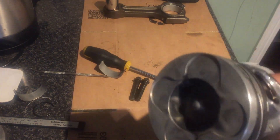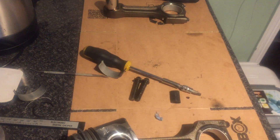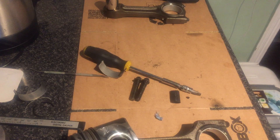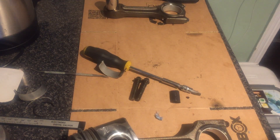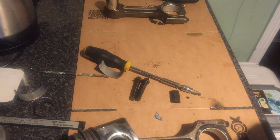There's our second to last piston. I'll do the last one and then we'll fit the last two. Then we need to go underneath and fit all the caps and torque them up. I do need to give the journals a good wipe as well because unfortunately they've been compromised with a little bit of surface rust. So I need to try and polish that off and then get the sump on so I can at least protect the bottom.